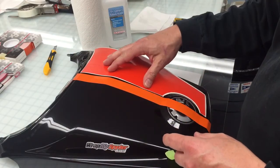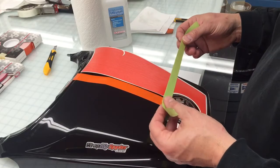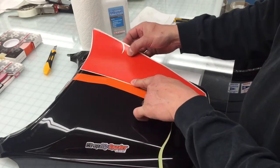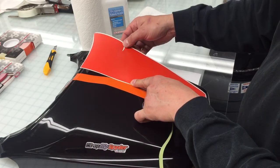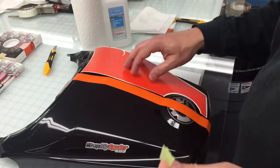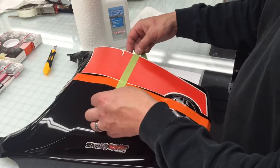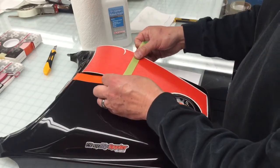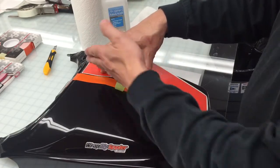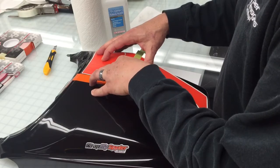You're going to position them to your liking, and you'll see the best place to set it for fitment as it lays on the panel. For this particular kit, because of that body line, we did have to add a decorative relief cut, which helps the film to lay down so that you don't get wrinkles. Position it where you like it, and you're going to use your one-inch gap tape as a spacer and a straight line so that you know you're positioning it in the correct area on the panel.